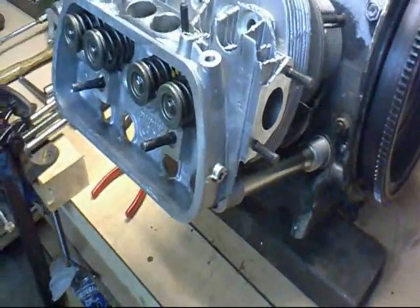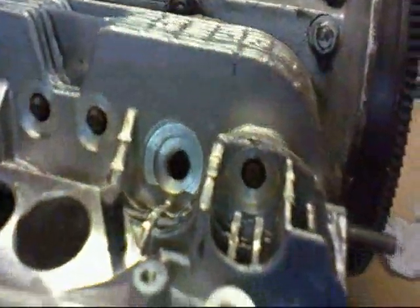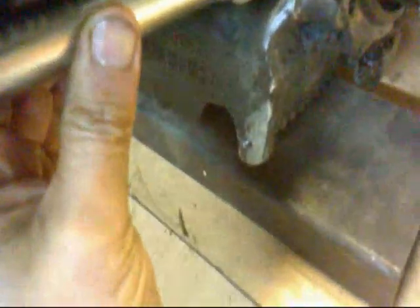Right, we've now pushed the head down a little bit. See, the studs are only just sticking out of the cylinder head. And we've got the pushrod tubes, les enveloppes in French, in, and we've got the actual pushrods, but they're just there to stop them from falling out, really. Now, what you do now is you turn the tube, the two outer ones you do first, until you see the welded seam, put that to the top, and do that for all four of them. Okay? Right.